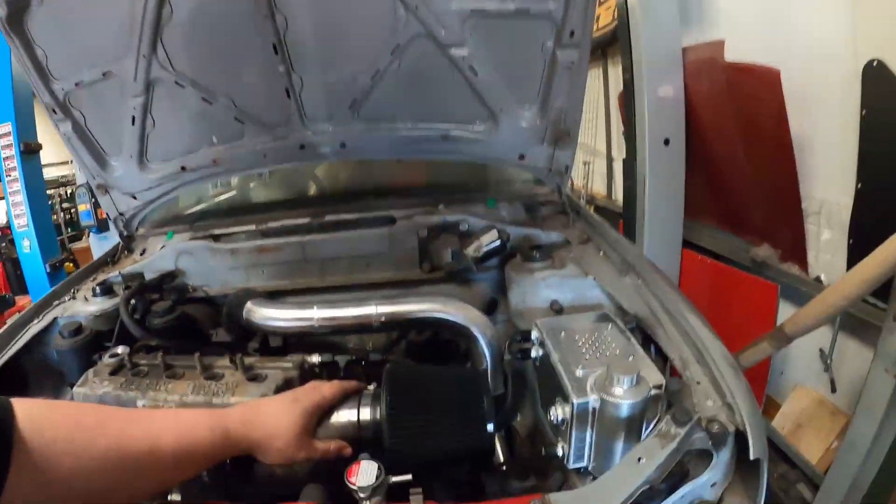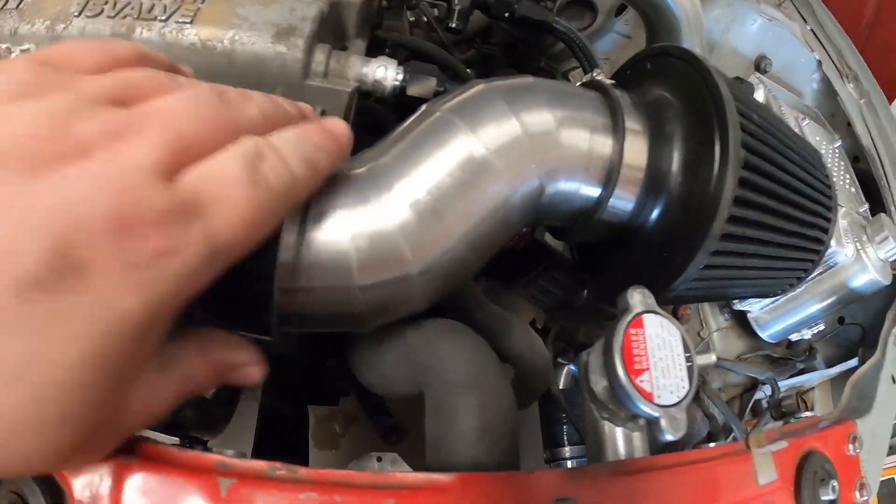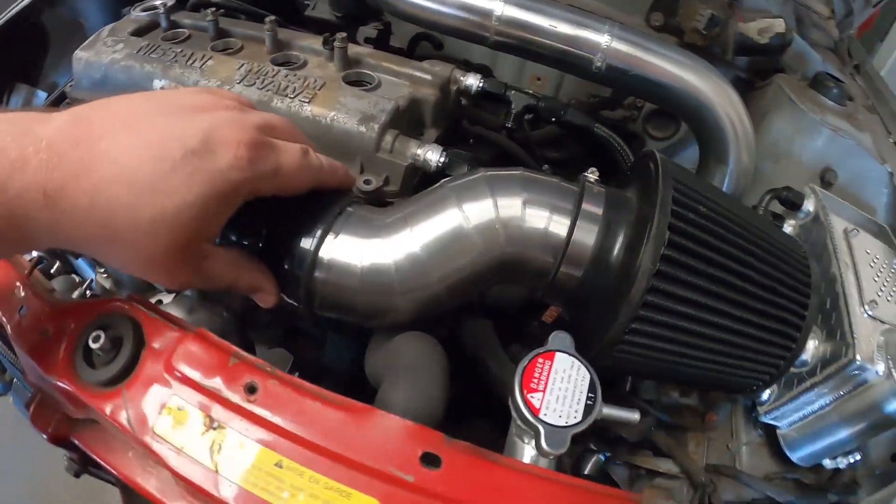If they are going to open screamer, there's a little top hat cap which goes in the downpipe and seals that off. A neat little solution — best of both worlds. We did want to put a small electronic bypass valve in there, but we couldn't find one small enough at an inch and a half — two inches would have been too big — and there isn't room anyway, so it's probably a good job we didn't do it.